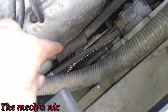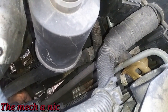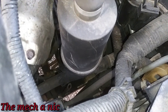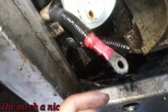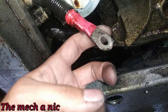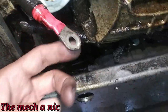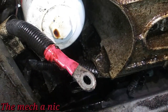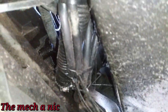I'm looking at the ground cable a little more closely and traced it over here, and I noticed this — this looks like a ground point, but it's not even connected to anything. It's just here. I guess somebody thought the engine doesn't need a ground. I'm underneath the car and I think somebody bought the same harnesses that I just bought — the power and ground side — but instead of installing them correctly, they tried to reuse part of the original harness and just splice into it, which is just a stupid idea.